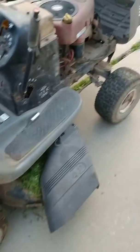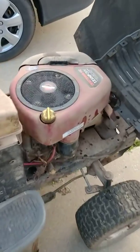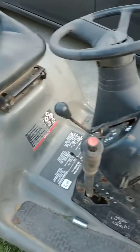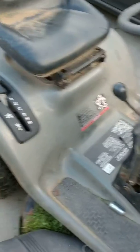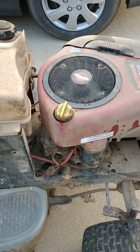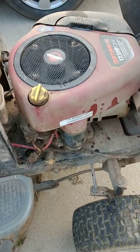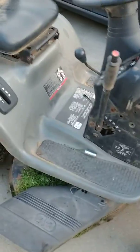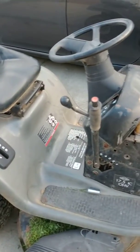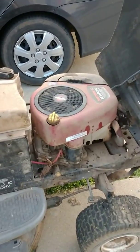It's just fouled. Maybe we should check the plug — we tried everything else. This old 17 and a half horsepower Craftsman runs like a champ otherwise. What happened was it was getting warmed up and it was sputtering, kicking, coughing, and smoking right after warm-up. It was running on that old plug, so we're gonna run it on the wire wheel and probably get a brand new one soon to get this old lawnmower running again.